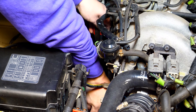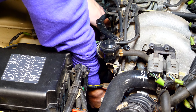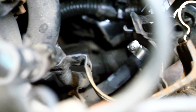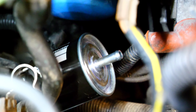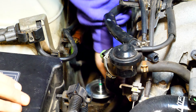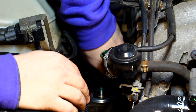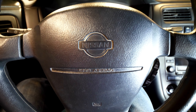This isn't exactly a hard job but it's kind of finicky because there's not a lot of room to work with. You can see that the fuel filter is installed right there with the little Phillips screw clamp that we need to tighten up. Once that's tight on the hose the bottom side of the fuel filter is attached. Now we replicate the exact same thing to the top one — we pull the filter up so it's locked into the little bracket found down there, then move the upper hose over, slide it over top of the fuel filter, and clamp it on just like we did for the bottom one.